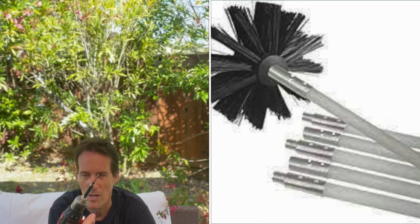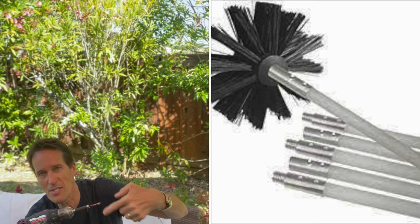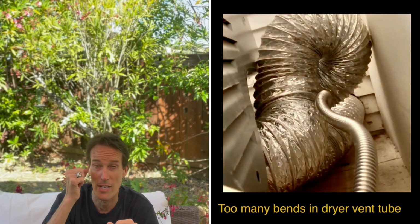If you do replace the high limit and you get your heat back, which is really cool, you may still not be out of the woods, because if you didn't correct the initial problem of the occluded dryer vent tube, it'll overheat again. So we're going to put a link in the description below for a video that shows how to use this really cool tool that you hook up to your drill that spins inside the dryer vent tube and gets rid of all the lint that's built up on the outside walls. So that's a really good thing to do, especially if you have a really long dryer vent tube, or you have one that has a lot of turns in it. You can get a buildup.